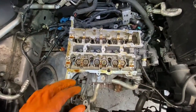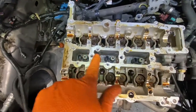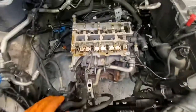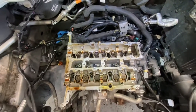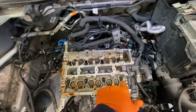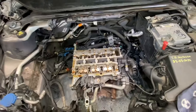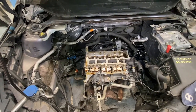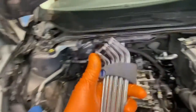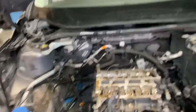I've pulled off the camshafts now. The tappets aren't hydraulic — they're shimmed — so just put them in the same order. On the injectors there are three little brackets that just lift out. I think the fuel rail is what holds them in place. Then we're into the eight head bolts — one, two, three, four through eight. I've taken off the water pipes off the water housing, so that'll come up with me and I can unbolt it out. I think we're on the home run now.